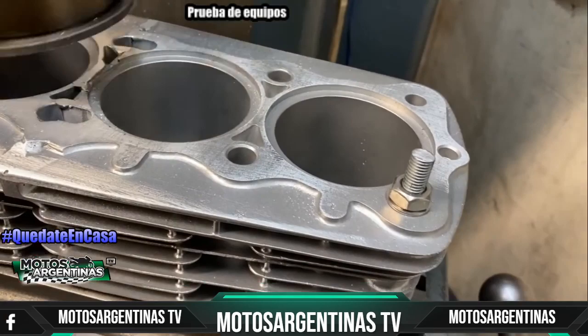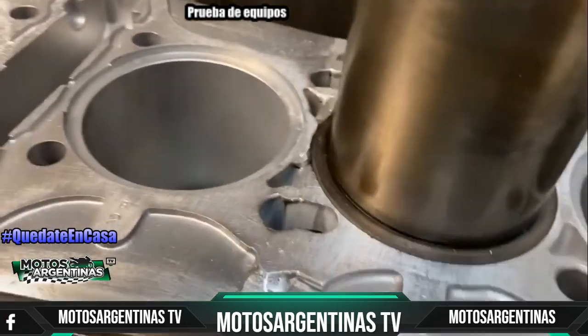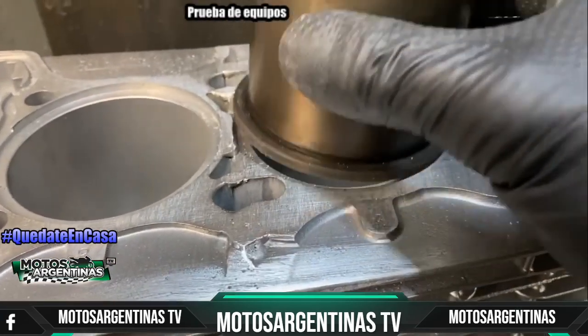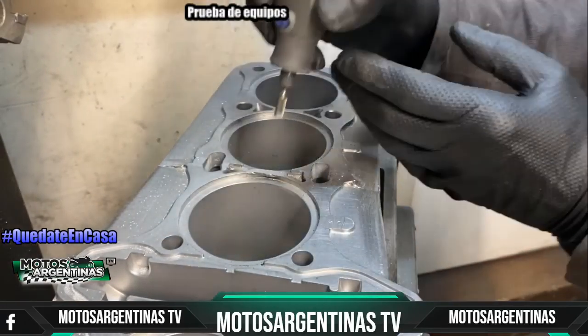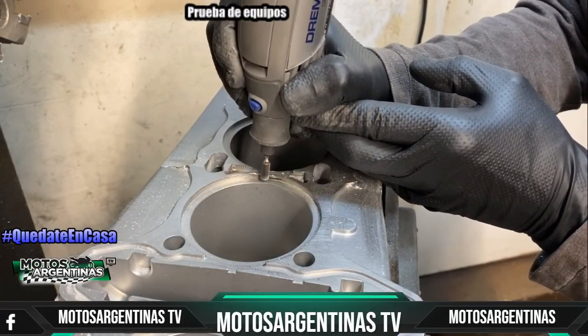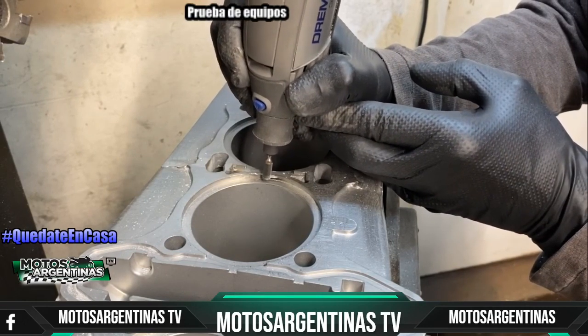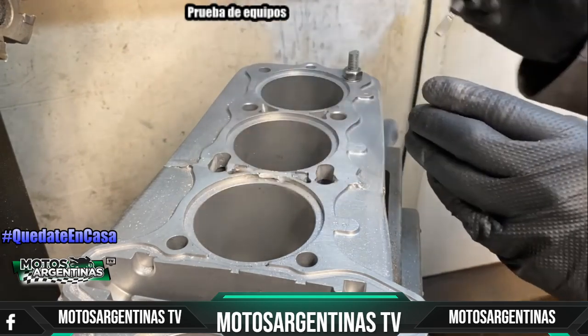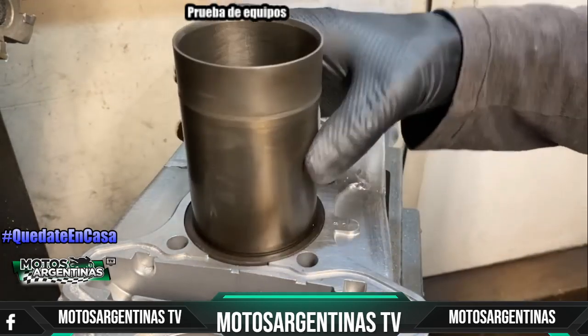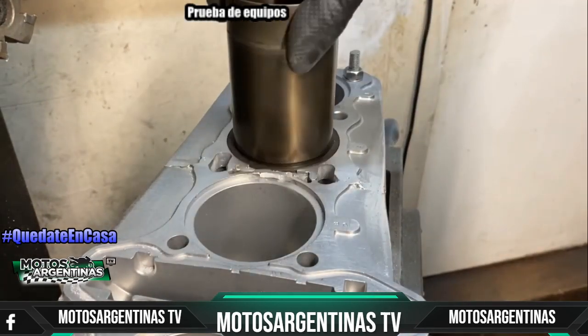I now had to remove some tiny bits of weld on the surfaces of the recess where the liners go. So I used my Dremel with a carbide burr, very carefully removing weld from the side only, being careful not to touch the flat face at the bottom of the recess. A quick check with the liners to make sure they fit, and they fitted lovely.